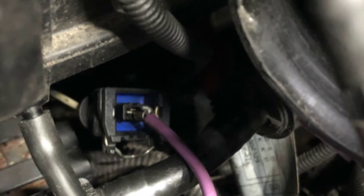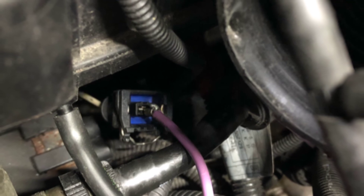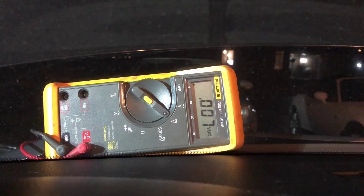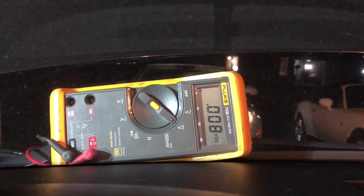See that white wire? That white wire is supposed to connect to the back of the starter. It came apart during the install and ended up connected right beside the starter — that's the reason why. Now I can start the car. Going to look at the ignition switch connector and press the brake.